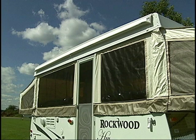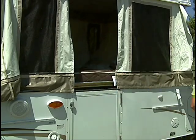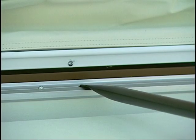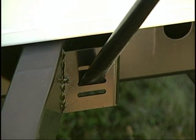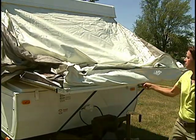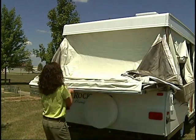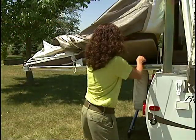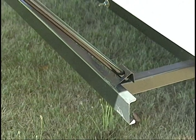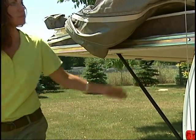The next step is to determine the type of bed support poles included with your tent camper. If you have double pole bed supports, install the poles by inserting the clip into the bracket at the top of the tent camper wall and into the bracket on the tent camper frame, then slide the bunk end out until it is fully extended. If you have single pole bed supports, slide the bunk end out until fully extended, then remove the support poles from under the mattress. Insert the round end into the frame and, using your shoulder for leverage, raise the bunk and insert the flattened end into the clip, locking the bunk into position.